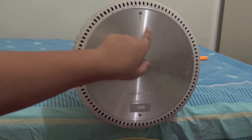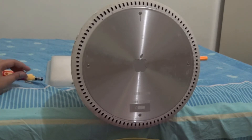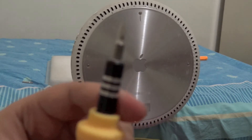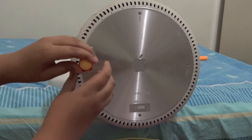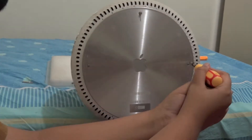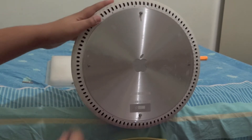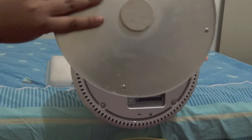Let's get started. We have to open up the base, and there are four Phillips #00 screws. Go ahead and take your screwdriver and put in your #00 screw bit. The screws are attached to the bottom plate so they never fully come out — just pull the plate and it pops right off.